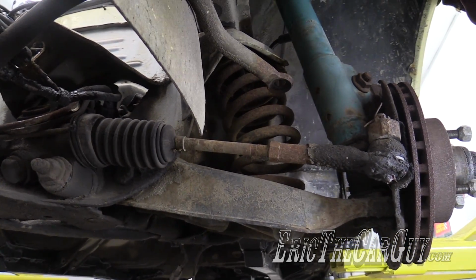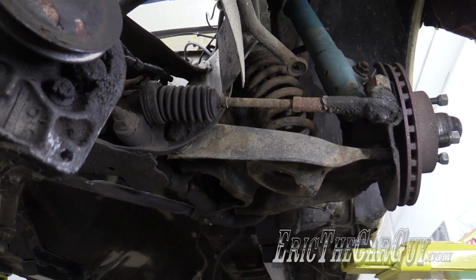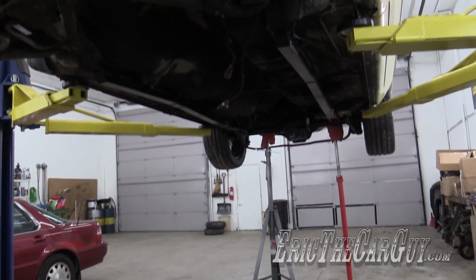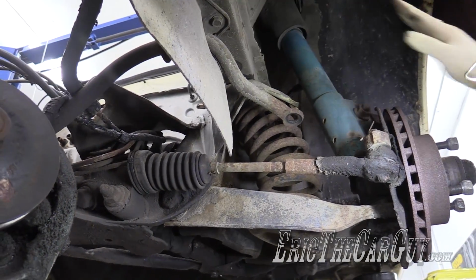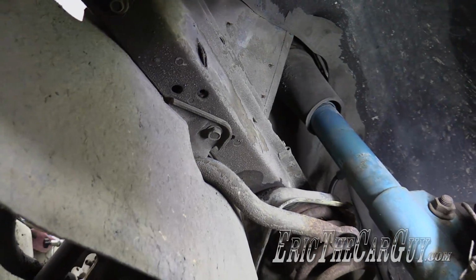So what I might do is take my braces and supports out, get those out of the way, drop it down, open up a bleeder valve, push the brake pedal all the way to the floor so it stays there, and the master cylinder won't let any more brake fluid bleed out, so the system won't bleed out while we work. That'll cover that side of it. Then disconnecting the struts at the top to let those drop down. The rest of it is really just 8 bolts.